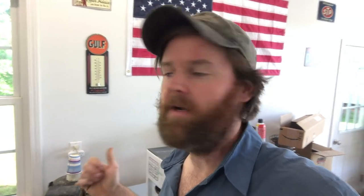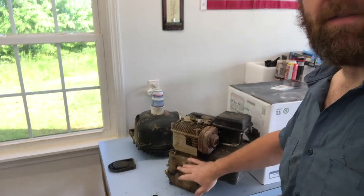The customer wanted his water pump — it was hooked to a water pump he used to irrigate his garden. He had a lot of trouble with this engine to start with, so he went and bought a 212 Predator from Harbor Freight. Same PTO shaft, everything should bolt right up. We already took the water pump off the engine to make sure the internals were still okay before he spent money on a new engine — and all the pump internals look good.